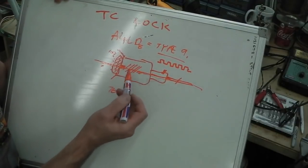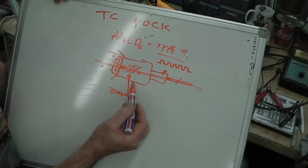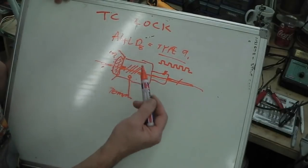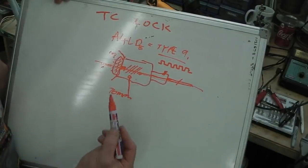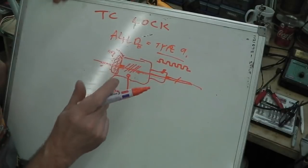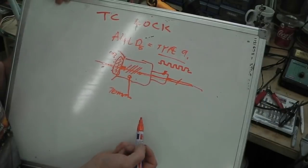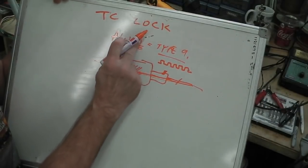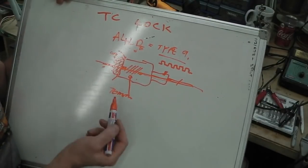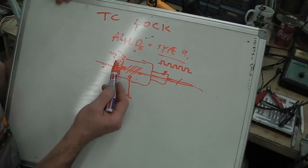And then there's a third one, where the overdrive gear itself was also controlled by the computer. So you'd have two plugs on it, or a 3-pin plug, whereby the computer would tell it to go to the overdrive gear and control the lockup. That way you could have what's called sport mode or icy slippage mode, a little symbol of a snowflake on it. But ours is not that one, it's just the midway A4LD, and I think they denoted which one by a small D and a capital D, and then an E at the end for electronic. Quick overview there of what we've got on Project Bramble. This type of gearbox with this torque converter with the lockup.